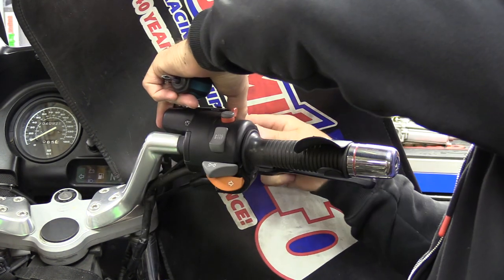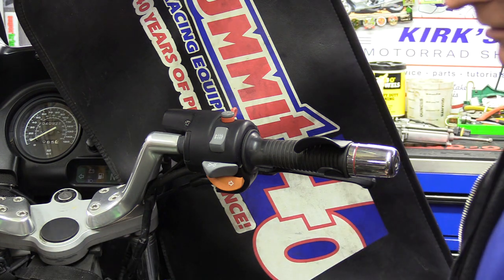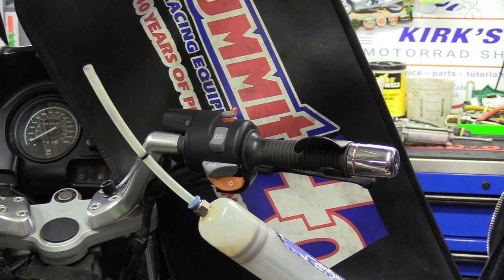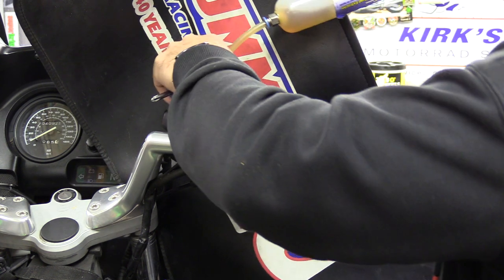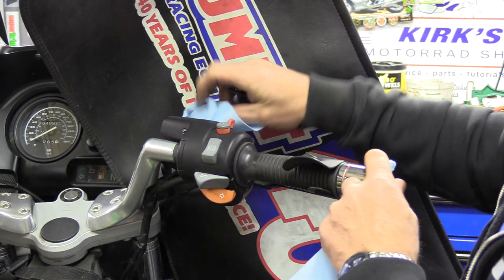Position the reservoir so that it's mostly flat. It's going to be tilted down but that's the way it is — if it drips out it's no big deal, you're going to remove it all anyway. I like to keep everything in a little magnetic tray. If these haven't been off in a while, sometimes you have to take a small flat blade screwdriver and break that little seal loose. This one definitely hasn't been done in a while because the fluid is quite dark.